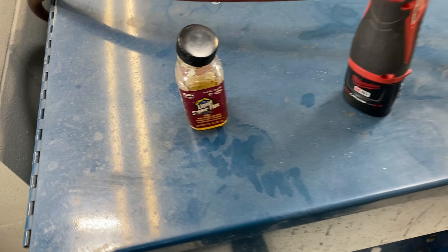So we have a problem with this circuit board right here, and it could be the surface mount LED. I'm going to try and just warm up the solder joint quick and see if that's a problem, because I've seen it before. So I just did a quick re-solder on the surface mount LED pins. It's not as bright as the other one.